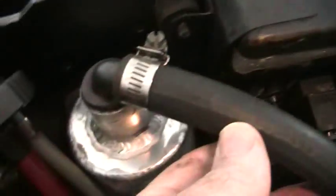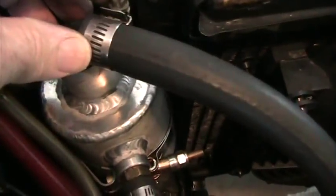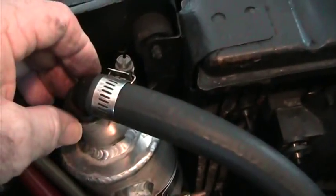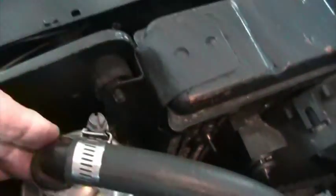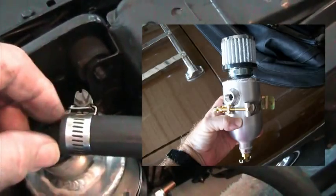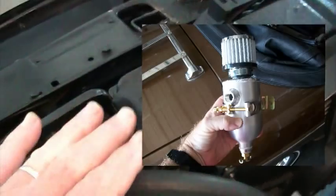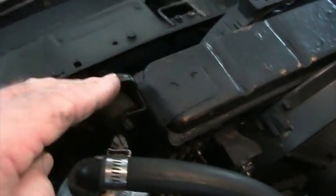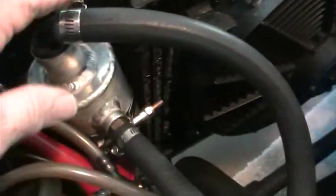Well, let me tell you something. That exhaust from that breather pipe goes into there. It separates it — the moisture falls down, the air comes up. I took the filter off and put a cork in it — a rubber cork. I reamed the hole out bigger, put an elbow in, just because I had to limit my head height. It was getting a little too tall — I want the bonnet to come down. You're fighting for space in here. Now it comes out of the top.